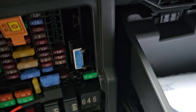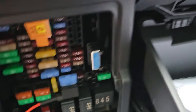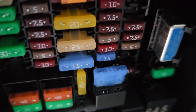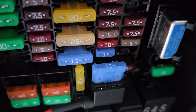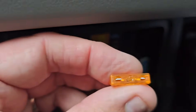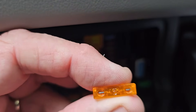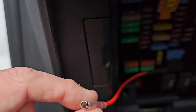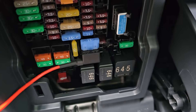That's now plugged back in. I've put the original fuse in the first position of the fuse holder — the one nearest the prongs — and then I need to insert a little 5 amp fuse into the second set of prongs on the fuse holder. That will then bring this live when the ignition's on. Stand by, I'll be back in a second.